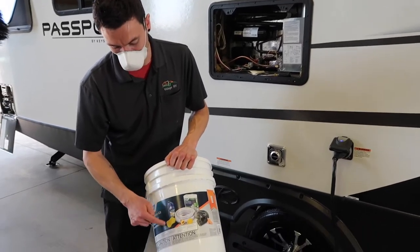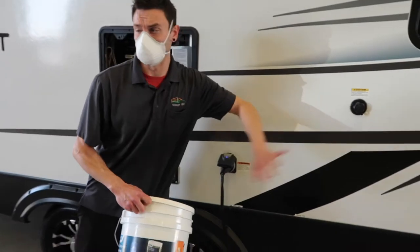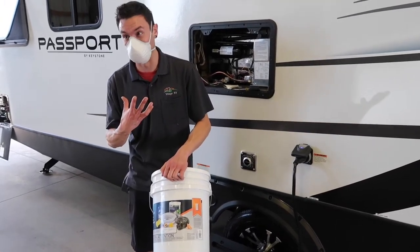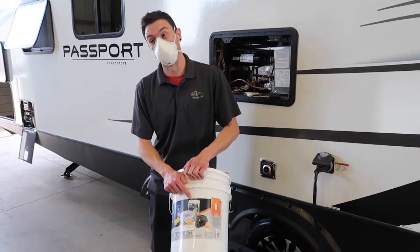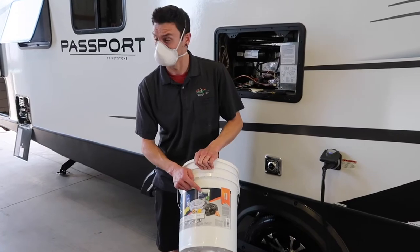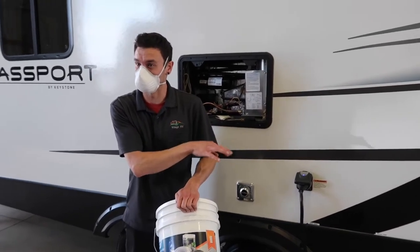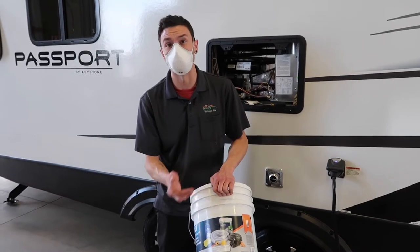In the compartment there's also a wash-and-wax with directions on the bottle, and a 25-foot fresh water hose for the Sani-Flush or hooking up your water. There are also deodorant packs you can put in your toilet as you use it — since flushing the toilet opens a straight airway from the black tank, these make it a little more bearable. There's also RV toilet paper — it's important to always stick with RV toilet paper. Charmin and Purex don't break down as easily and can lead to clogs, and they also tend to clog up the tank sensors, making them read full when the tank is actually empty.